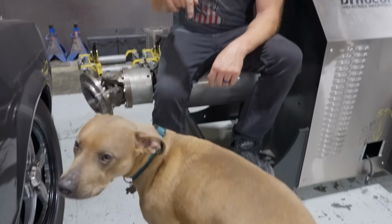All right, so after me and the dog talked about it, we figured it out, and I actually think we almost put Perry's car back on the dyno, because we should have locked up the converter and started it with a locked up converter. Then it wouldn't have been slipping the converter, which was really multiplying the problem and making it accelerate so fast and drive right through it, because the dyno would have at least put some kind of load on it. Probably not full, but some kind of load.